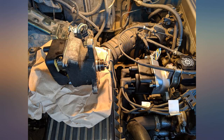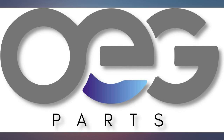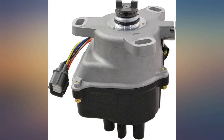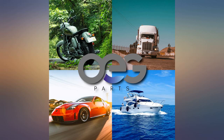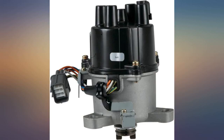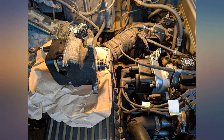Good instructions but YouTube was great on diagnosis and how to do it for me. 2 important steps: make sure the rotor on the old one is in the same spot as the new one. This requires removing the cap on both old and new, and marking on the old one where it is with a marker or scratch with a screwdriver — this is important for timing being the same. Some play where bolts tighten in slots, and be careful on old wire plugs as they get fragile over the years.